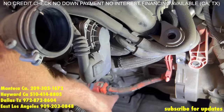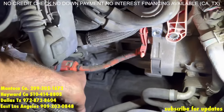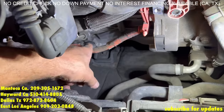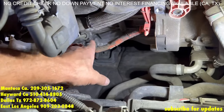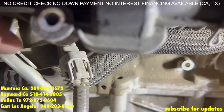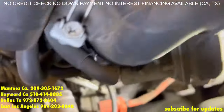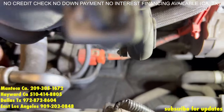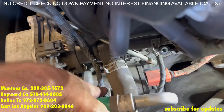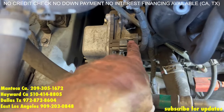Next, we're going to remove the oil level sensor — it's on the side of the block. Take the black AC compressor clip, not the orange one. You're going to remove the black one, it's a small one right there. You're also going to remove this clip that goes to the knock sensor. You're going to remove the plastic clips that hold the wires in place — there's going to be three right here, and the water pump connector.